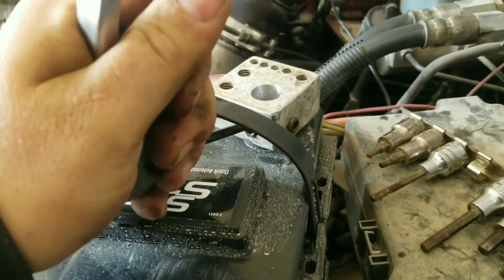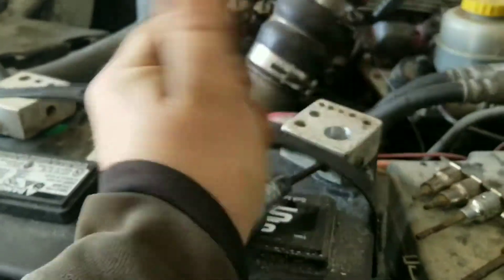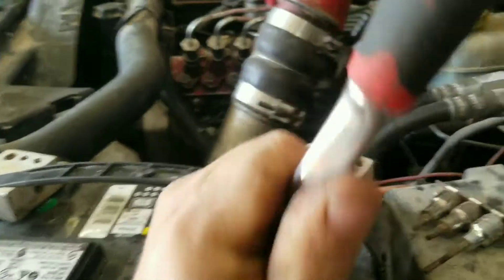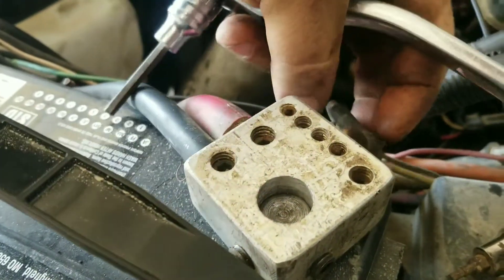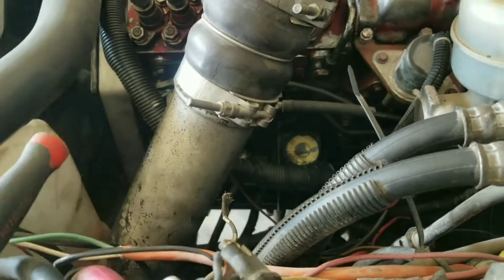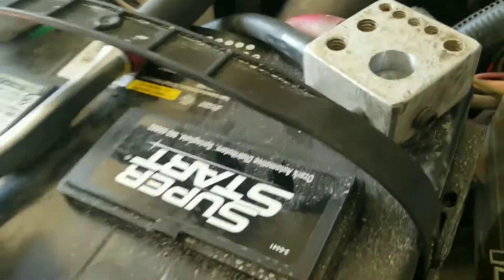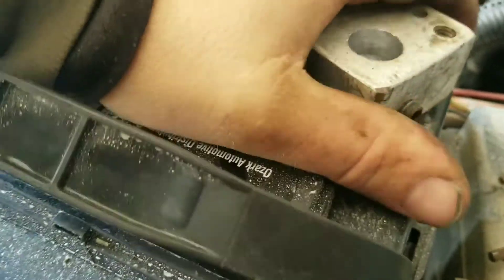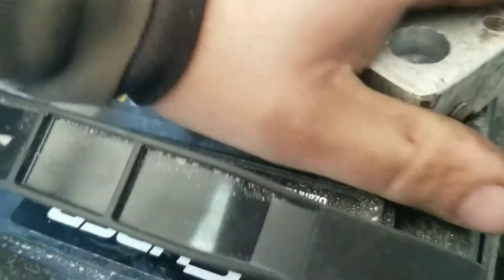I made these battery terminals when I was younger — I had an amp and speaker in the back and it works really nicely for having all your extra plugs in here. If you've got several different things plugged in, you don't want all that conglomerate mess sticking on a terminal or a post. It just makes it a lot simpler. I thought maybe they wouldn't corrode as bad either, but they do. The aluminum and the lead, being two different metals, they do still corrode.